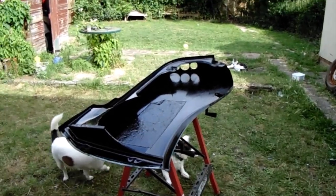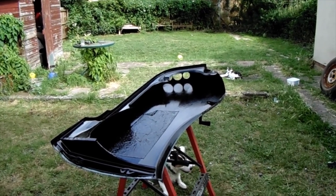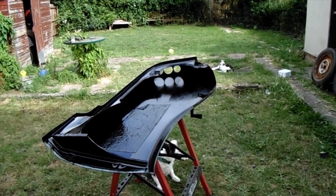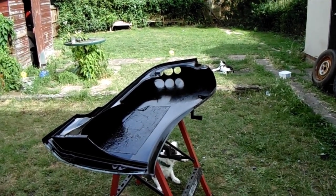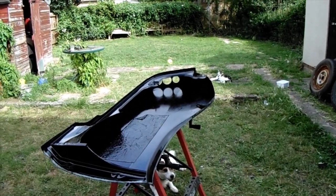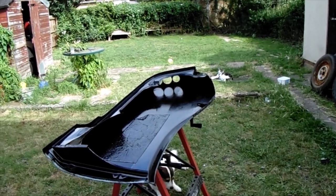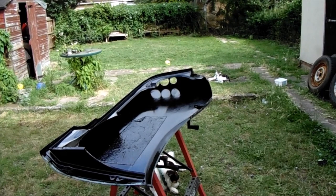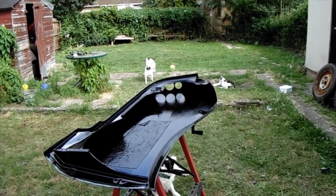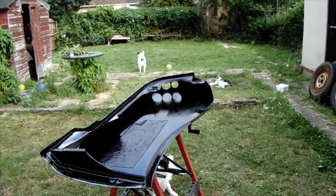That's probably why I was in hospital all the time. So there we are — that wing is done roughly. Tomorrow I'll give it a good wipe off, do the odd couple of dent repairs with a tiny little bit of filler, not much, and give it a good coat of primer. I'll fit it on the car once it's primered — I shan't bother spraying the top coat yet. I'll leave all that until all the panels have been stripped down and done. This one's been taken back to bare metal. There's another rear wing that needs to be taken back to bare metal, a front wing as well, and then the wing that's actually on the car — I'll probably strip that right back to bare metal too. I prefer to go right back to bare metal; it takes a long time but it certainly looks a better job at the end of it.